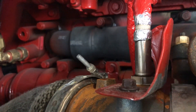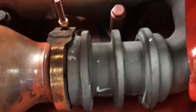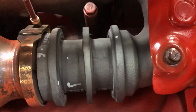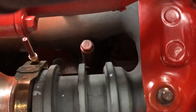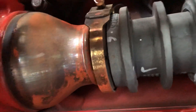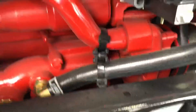This is a brand new engine with only about 2,000 miles, so we'll see how it does down the road. Another difference is the elbow that connects the EGR cooler with the exhaust manifold — this part is different. I think they changed it because they had a lot of trouble with the gaskets. The EGR cooler itself is now round.